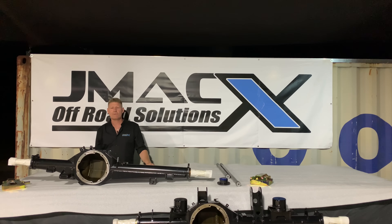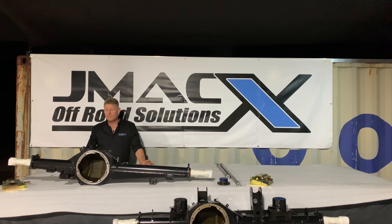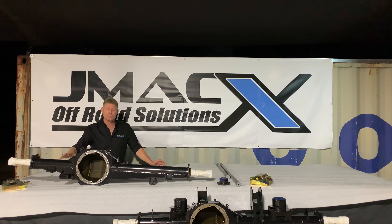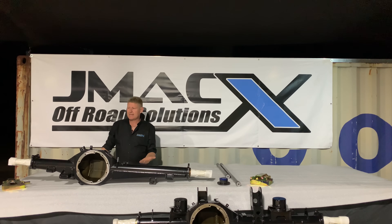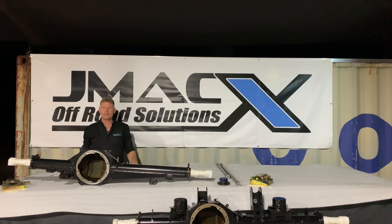There's also the issue of rated wheels and tires — as you increase the load rating on the back you have to upgrade those parts to meet that rating. The housing we manufacture is 350-grade 6mm drawn-over-mandrel tube with bracing. Some people say 'we use 9mm and no bracing and it's stronger' — but through testing, even for armored companies, a 9mm tube without bracing is actually no stronger in reality than 6mm with bracing. You can put a load directly on these things and the ratings go through the roof, but that's not real-world.